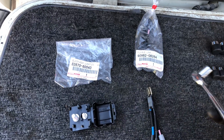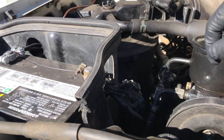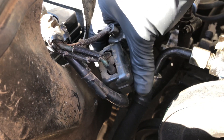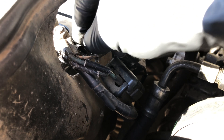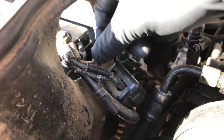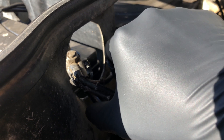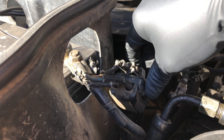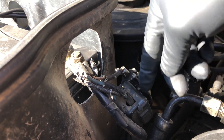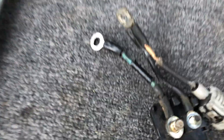Or you can copy them off the screen here. The last thing I'll mention is if you're ever away from home or out in the middle of nowhere and you identify that you have a bad fusible link, you could actually just jump the cable just to get you back on the road and get back home. This isn't 100% recommended because you need that fusible link — it's important because it's supposed to fail, it's supposed to melt in case there was ever a surge. You don't want your entire wiring harness to burn up. Use this information wisely — don't do it just because you don't want to buy a fusible link. But if you just need to get back home or out of a sticky situation where your Land Cruiser won't start, you could totally do it — just do it with caution.